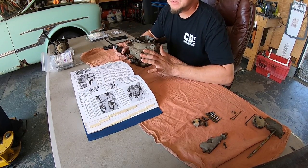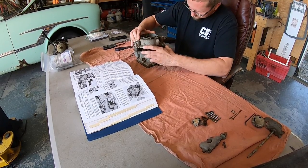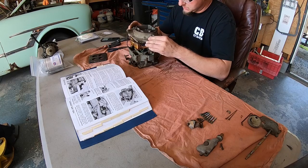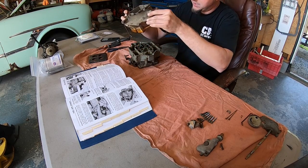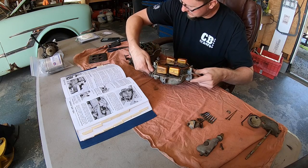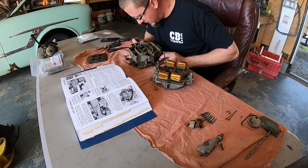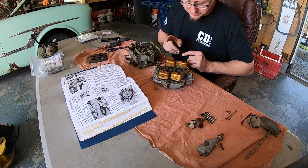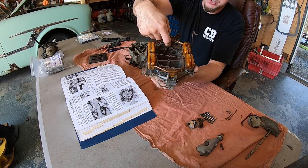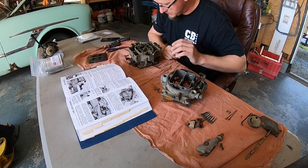Alright, so we've got all 16 screws removed from the top of the carburetor. After much fighting I finally got the air horn assembly to dislodge itself from the base of the carburetor — kind of funny looking. These are all your floats here, actually attached to the air horn. What I was having problems with was this plunger right here, which finally came unhooked. Now that I can see how it works, I know how I should have taken it apart — there's a little eyelet and a plunger down in the carburetor base that hooks into it. The plunger is stuck down inside the carburetor base so I'm going to have to work on getting that out.